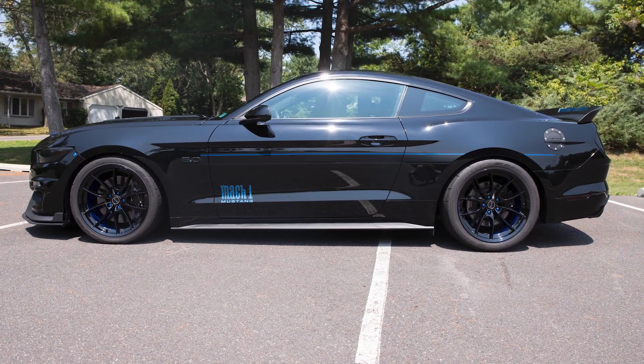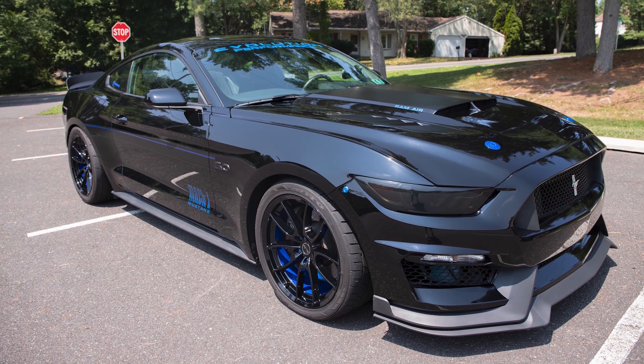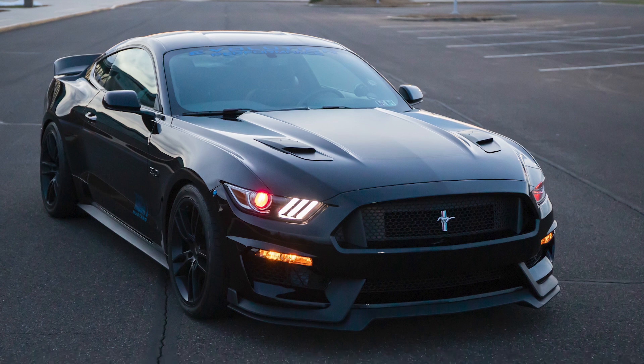Let's segue now into future modifications. Maybe a tune down the road — is there anything you have your eye on? For the most part I am done, but the one thing I will do is definitely a tune and basically what I'll call a stage four to the car. I'm going to be having engine work done — probably forged rods and pistons. I'd like to get up into the 800 horsepower range. That's going to be a big modification because of the oil pump gears, front rotating assembly — and when you start reaching that, you probably need to do pistons and rods and a handful of other things. Ford did a hell of a job on those 2015 through 2017 engines, but nobody wants to be a stock motor hero to a certain extent.